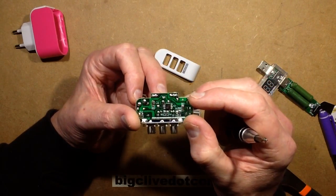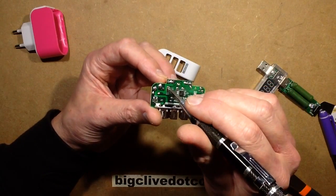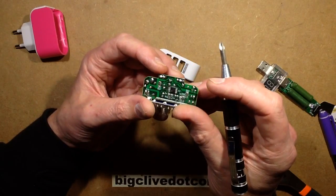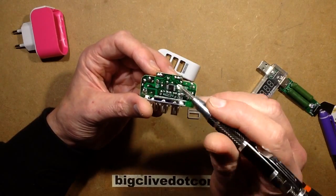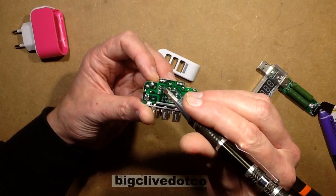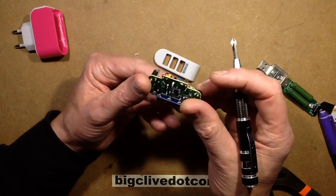There's a little resistor just tagged across — a surface mount resistor that has not quite soldered. It's a surface mount resistor that's supposed to cover these two pads but has slipped off. That looks like the component — because there's a diode to it — that is supposed to filter the spikes from the transformer. It's probably across the transformer's primary. So it looks like the spike filter that's designed to protect the chip from spikes, meaning this probably wouldn't have lasted too long in proper operation, because it's not working — the resistor is completely missing.